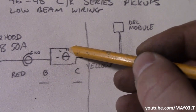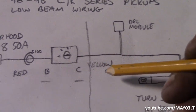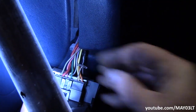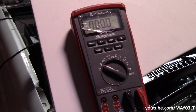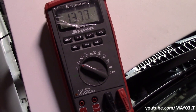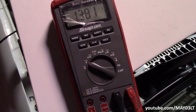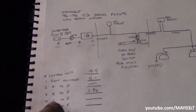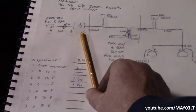When we turn the headlight switch on, power goes through the contacts in the switch and comes out of the yellow wire we're going to probe. There are two yellow wires in this connector but I've already identified the correct one. I clip my red meter lead to that wire. Since the headlight switch is off, no power is going through it yet. I turn the headlights on — for argument's sake, we'll say 1.4 volts. I turn the headlights off right away to avoid killing the battery. We just tested the yellow wire at the headlight switch — C to F — and had about 1.4 volts of drop.